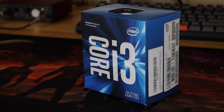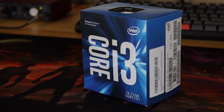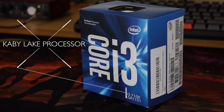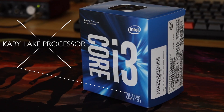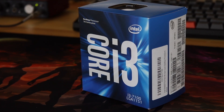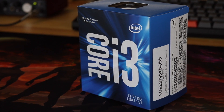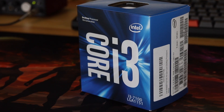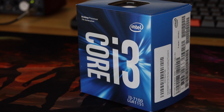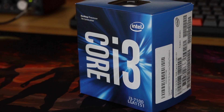For the CPU, I decided to go for the Intel Core i3-7100. I picked an i3 instead of a more powerful i5 or i7 because I was looking for a low-power processor that can be easily cooled and doesn't require too much power. No K letter at the end of the number, because I won't need any overclocking capabilities at all. The Kaby Lake processor also offers integrated Intel graphics, capable of a resolution up to 4K at 60 frames per second — and for me, not being an intense gamer, it's more than enough.